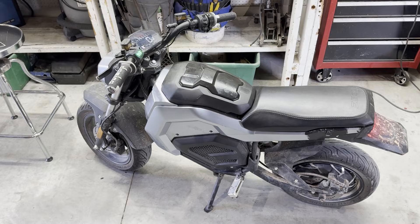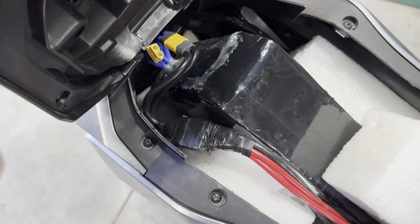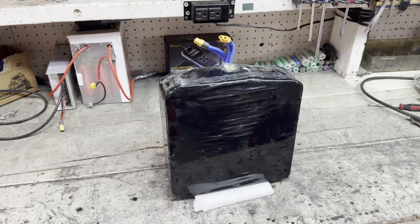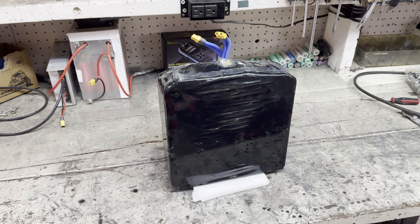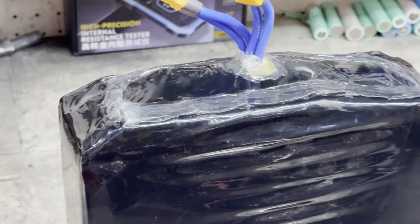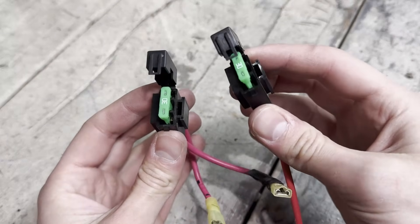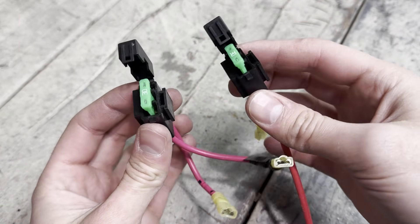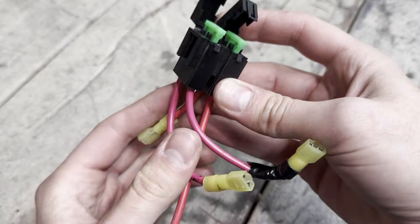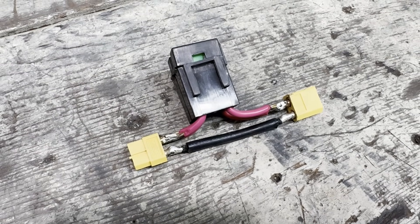To test the pack, I put it in my Ego minibike. I started on mode 1 at 50 amps and it worked perfectly. I then put it on mode 2 at 100 amps and expected it to trip pretty quickly, but it just wasn't tripping. So I went all out to mode 3 at 200 amps, and it was still not tripping. I was pulling 180 amps through this 50-amp BMS for about 10 seconds doing pulls, which is not good. This is why I'm never using these dumb BMSs again — you just have no idea what quality you're getting. Luckily, the stock Crazy Cart had two 30-amp fuses I can put in parallel to serve as overcurrent protection for this pack.